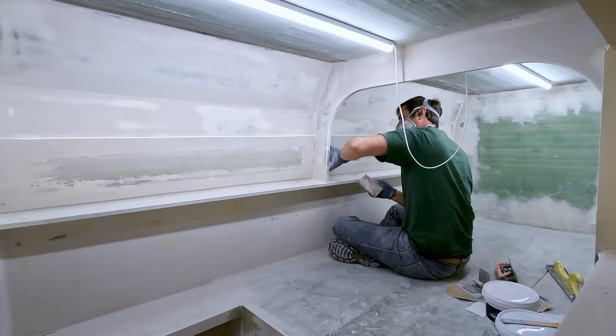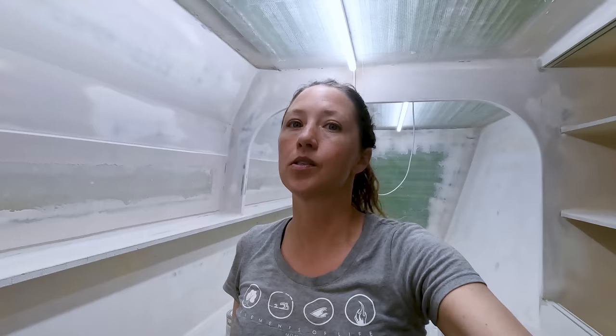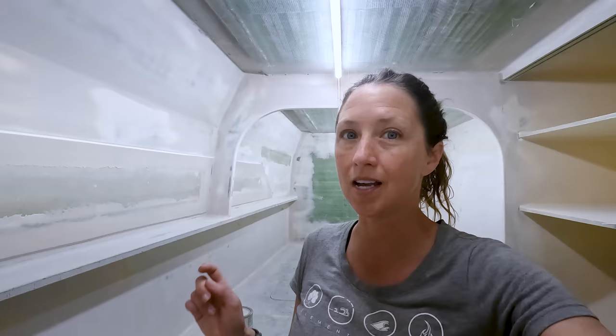I've trusted Matt with the camera for the past day and a half as he's worked in here, and he promised he got some footage of himself blocking and working with the epoxy fairing compound from Total Boat, since we are now working with an epoxy-based primer. Hopefully he got that footage, because it's time for me to take this card, finish editing this episode, and get it uploaded tonight. I can see where Matt has gone through with some of that epoxy fairing compound, applying it to a couple of edges. He'll let that dry, sand it tonight, and then hopefully tomorrow we'll go back for another run of primer. That will be in next week's episode — stay tuned and thanks for watching.